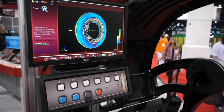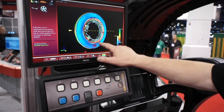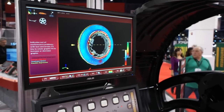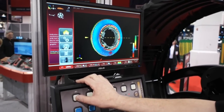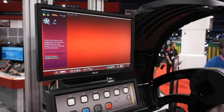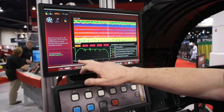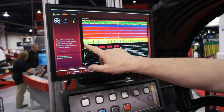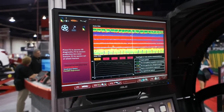So this wheel needs to be taken from here, put onto the tire machine, appropriately deflated and inspected, so that we can create the correct bead seat for this assembly. The machine will also give me the contour of the tread, the tread depth, etc. And also, from zero to 360 degrees, it will actually tell me if there are any flat spots on this assembly.